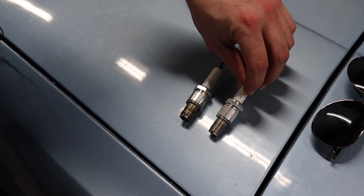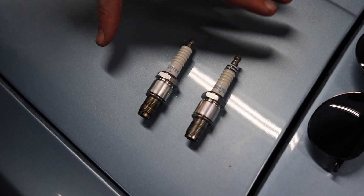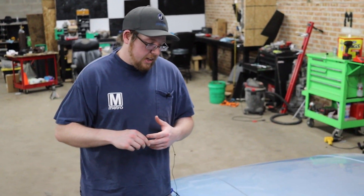You can get colder plugs in a 9, hotter plugs in a 7 — they come in all different ranges. But these are the factory ones for the Turbo 2. Why would you want colder for trailing? Because it's on the back end of the burn and it's also the first plug that comes into contact with the air-fuel mixture. You don't want that hot — if it's hot it'll pre-detonate it, and bad things happen when pre-detonation happens: massive combustion chamber pressure spikes, cracked apex seals, dented rotors, cracked irons on the dowel landing.